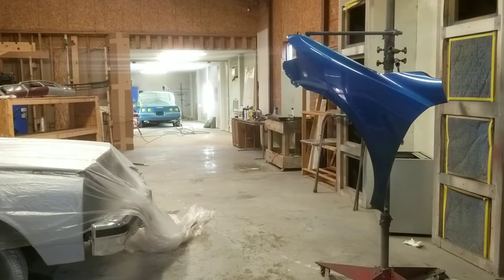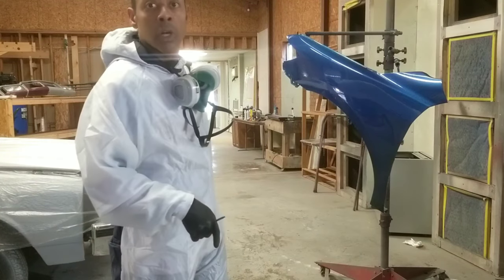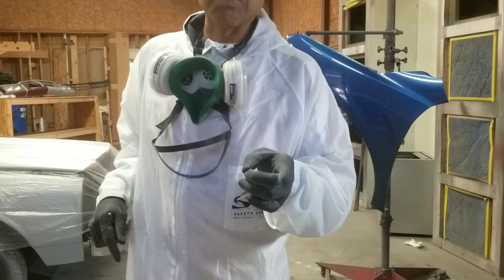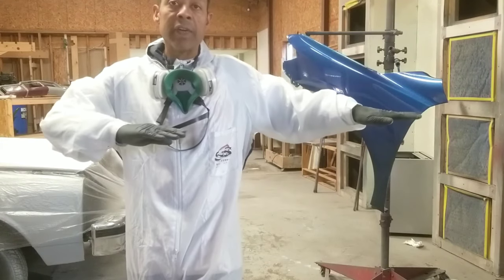The Bulldog — love that stuff. So we're going to run back here and take a quick look up close at the Corvette, and then I'm going to shoot some more primer. And we're going to shoot that base coat and clear coat with metal flake, and then two more coats of non-metal flake, just spray clear to bury the metal flake.